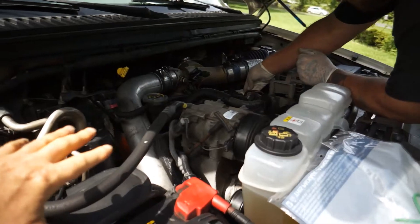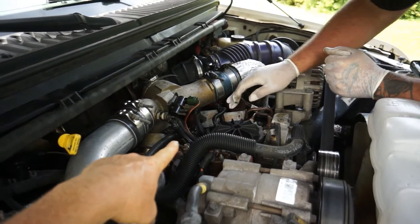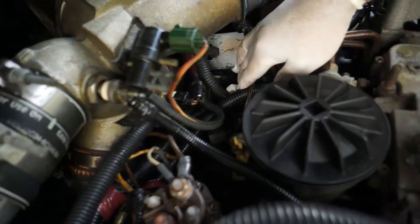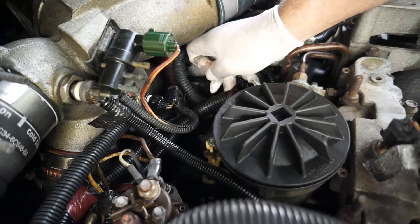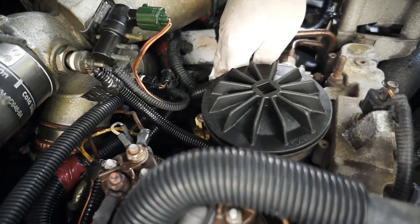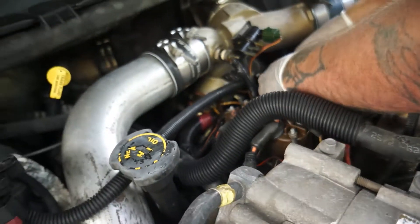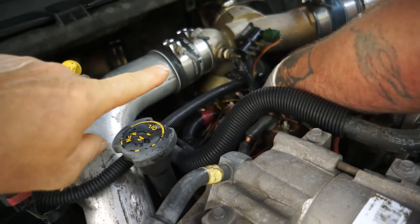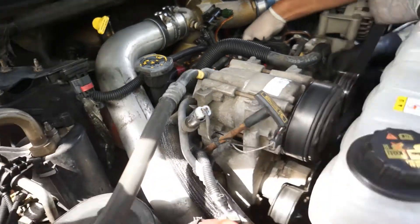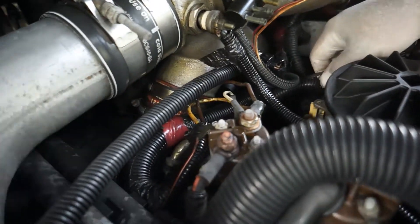Today after it dried, we started up the truck and June noticed the high pressure lines in the back - one of them is leaking. Yeah, they're rubbing each other right there in the middle. You can see in the middle they're rubbing each other, so they rubbed through. We're gonna try to stop that and make sure they're zip tied with some rubber in between them.